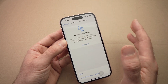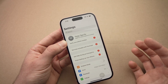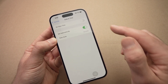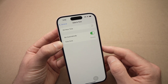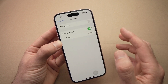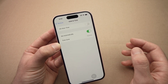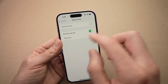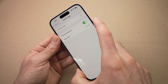The last thing you can try is to go back to the main Settings menu, go into General, then Date & Time, and make sure that Set Automatically is turned on — it should be green. Sometimes when you set the date and time manually and it doesn't match your network's date and time, the 5G won't work properly. So make sure it's set automatically and the time zone is correct. After doing this, force restart your iPhone the same way I showed you — volume up, volume down, then hold the power button.